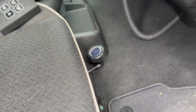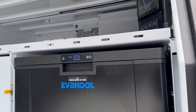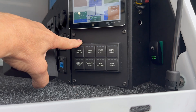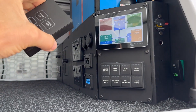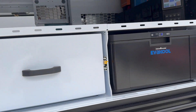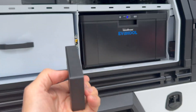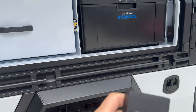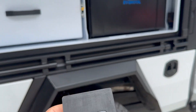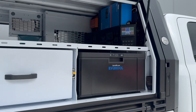So we've got three ways of switching: we've got the one in the cab which will also change color; we've got the CAN-bus — this is just a four-pin connector on the back here with custom-engraved switches; and we've also got the Bluetooth switches. The Bluetooth switches are probably not applicable in the vehicle itself, but if you've got a van behind — and we've got that switching in the van — then this can be fitted into the vehicle and you'll be able to control the van lights from the vehicle over quite some distance. We've tested this and it comfortably runs at 20–25 meters.